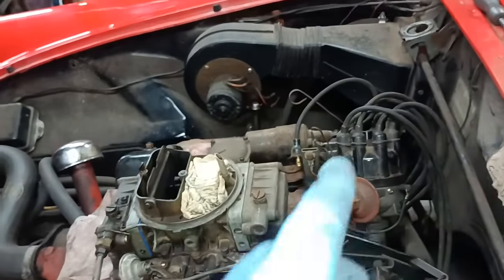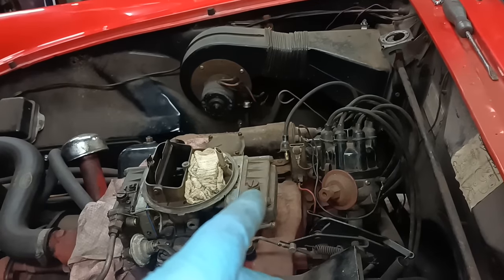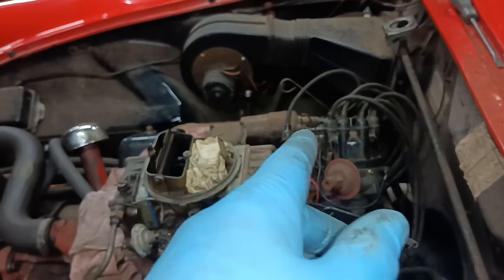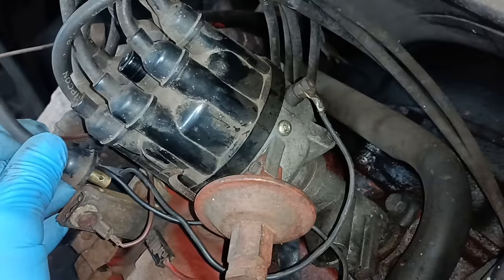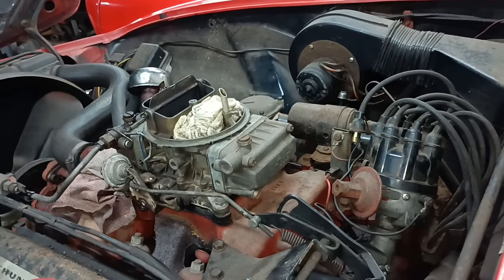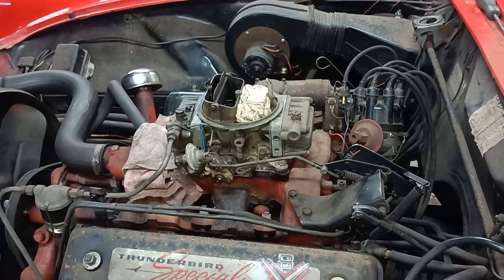Okay, I'll have to check the footage, but I think I made a bad mistake then. I think when I was looking for a spark, I disconnected the main wire at the coil rather than at the distributor. Anyway, let's see if it sparks now. I think that's ground there. Yeah, that's a decent spark. Okay, righto. Let's see if it'll run then.